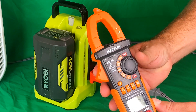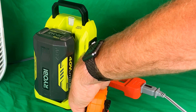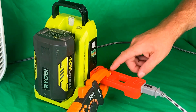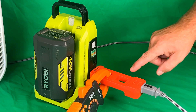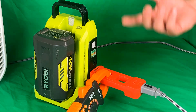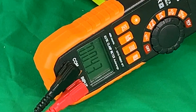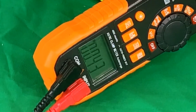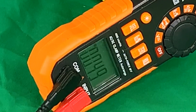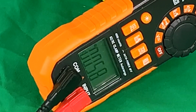I'm now going to switch the multimeter to the 40-amp setting. There are two different holes on this device — one gives you the actual amperage reading, and one multiplies it by 10 for small amperages, which makes it easier to read. We'll turn the fan on low speed — we are running at 0.43 amps. Medium speed: 0.49 amps. High speed: up to 0.58 amps.